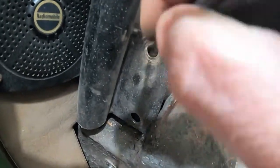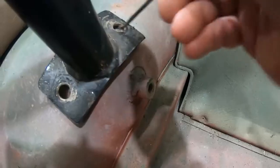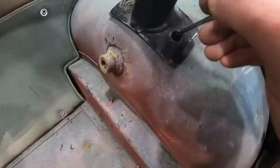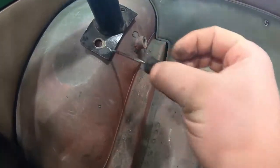I'm going to use a little scribe and just mark where the bolt holes are going to go, drill those — that one and that one — bolt them in, and then I can use a hammer and some heat to try and shape these to fit before bolting them in.